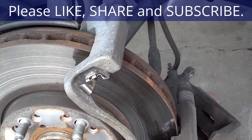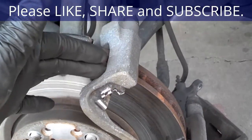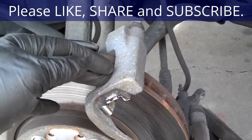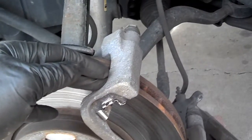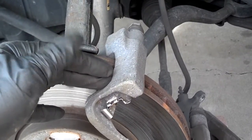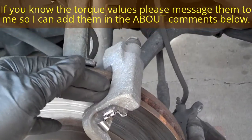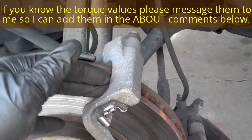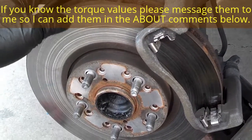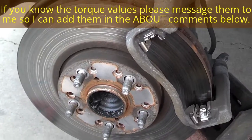Since I don't know the torque value of the bracket mounting bolts, you could put a torque wrench on there and break it loose to see what the torque value was — though that's not an exact science. It's best to ask a repair place or parts place, but it can get you close. When you take the rotor off, be careful that you don't bend your dust shield, because it'll be rubbing once you get everything back together.